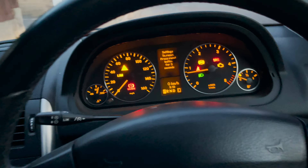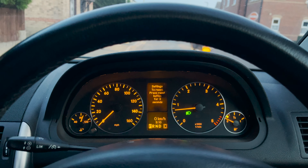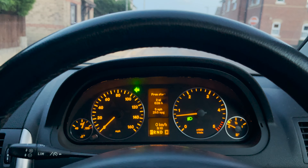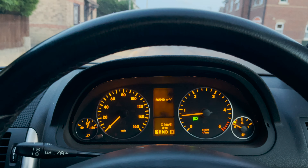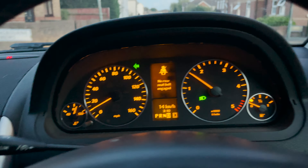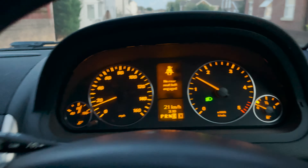Turn the car off and on again - we don't have the brake pad wear sensor message anymore. So no more brake pad wear message and no more ESP light. I've done the road test - it's kind of like a calibration - and as you can see I'll push the car here to about 30 miles an hour. No faults. The Autel did the job again of calibrating the car.